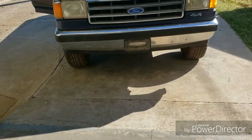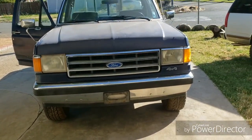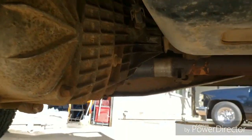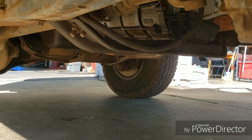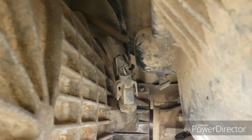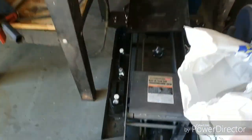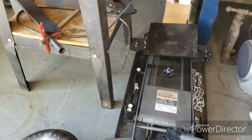The hardest part is the four-wheel drive — it's got a giant transfer case and it's right up against the gas tank. There's the transfer case, the driveline to the back, driveline to the front. There's not a lot of space to scoot out the engine, and thank god I got this jack because that is going to be heavy. I want to try to pull the transfer case and transmission out as one unit.